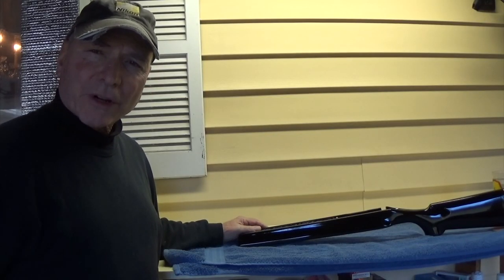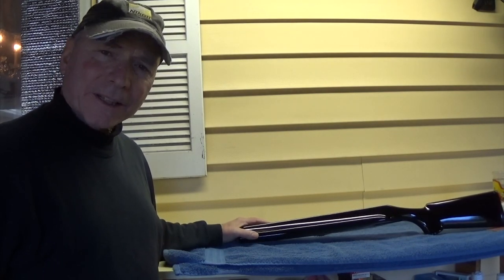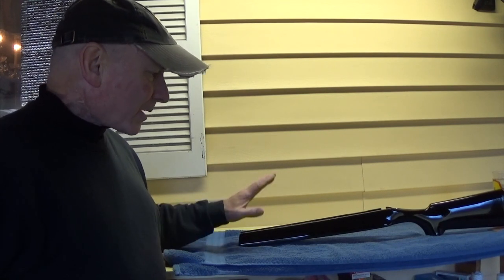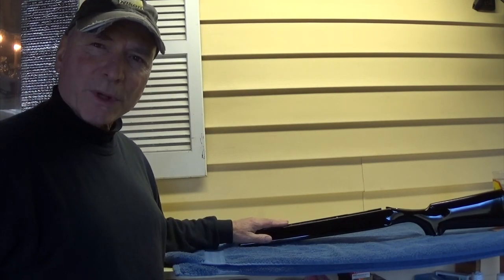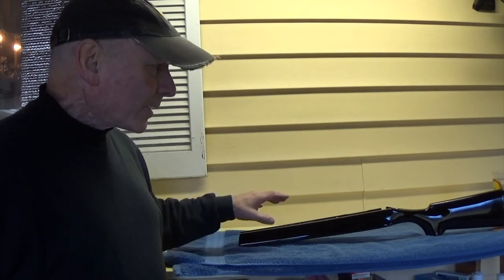For this to cure up a little bit, and this next step is what really makes the finish pop, and it doesn't really take that long, especially if you catch it in that window of time before the paint is completely cured. Usually within about a week the hardener and the clear will dry up to the point where it makes it very difficult to get rid of the scratches.